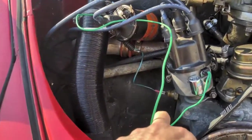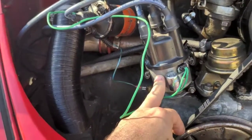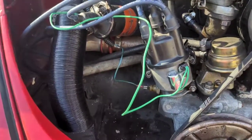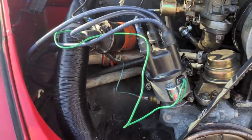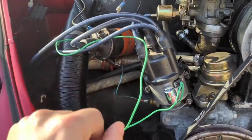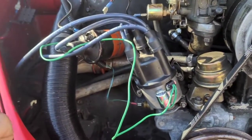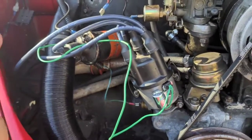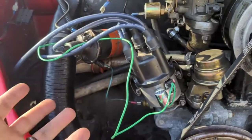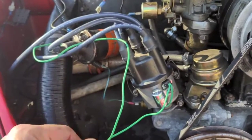One of the steps is to measure the ohms to ground. I was seeing about 0.2 ohms between the casing of the distributor and ground, so that seemed okay. On the positive coil wire input with the key on and not running, I was seeing about 8.5 volts. If I disconnected from the coil, I saw 12.5 volts. I attribute that to the coil actually being charged during that moment — it was sucking up some of it, given there's three ohms of resistance in the coil.